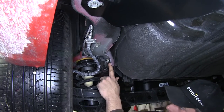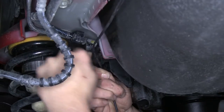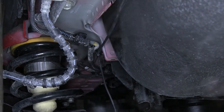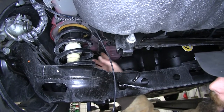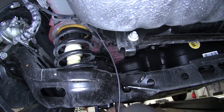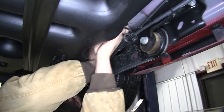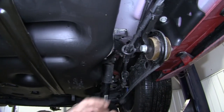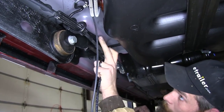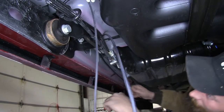The bar that goes across here has a nice little tab with a hole in it — I'm going to zip tie it to that to hold it up here out of the way. Once we get past this point we're going to see where our brake lines start to run up towards the front — I'm going to try to follow along with those. That brings us right over top of the shock mount and then over top of the fuel filler nozzle. Here you can see our brake lines come over in front of our bracket — we'll go right up above those.